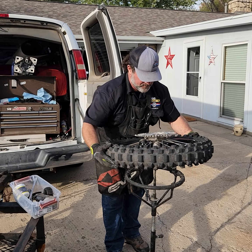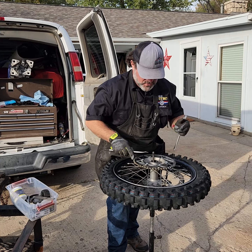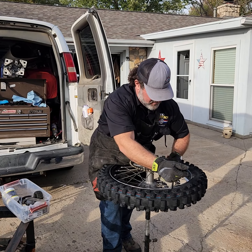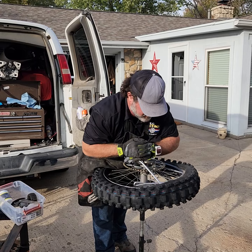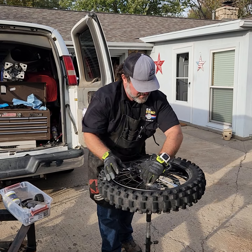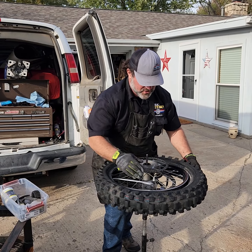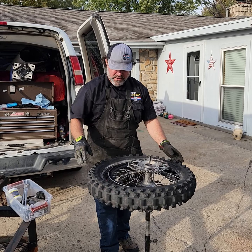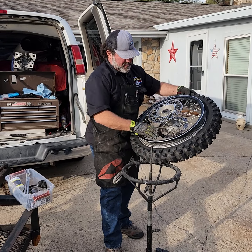We're gonna flip for the second side. Same thing — we're gonna put that rim lock at nine o'clock again and work our way around. Now this time the second side always goes easier. That's why we do sprocket side second, because it's easier — the rest of the tire is already wherever we want it to be. So again eleven and midnight, pull it, pull it. And I'll go ahead and use the third one since I've got it. Work your way around three or four spokes at a time. Now when you get to that last third or so, take your body weight, push on it — I can put my hand all the way down through there. The stem came out, it's already past the rim lock. Move the spoons out of the way, bring it around, nice little push, use the knee. Drop it — take it off.